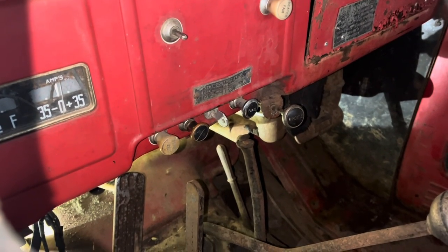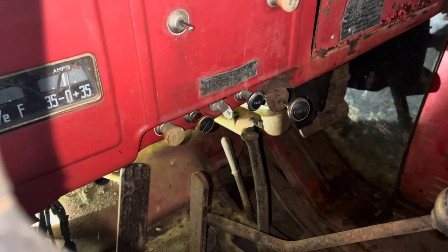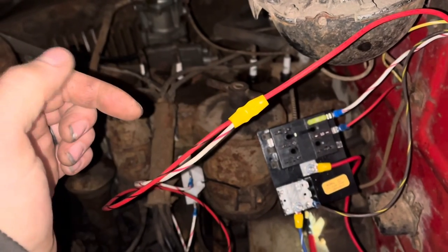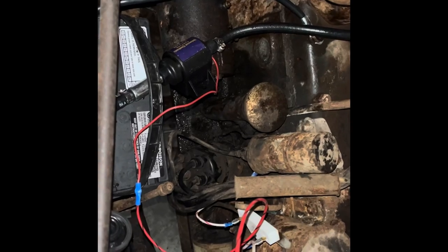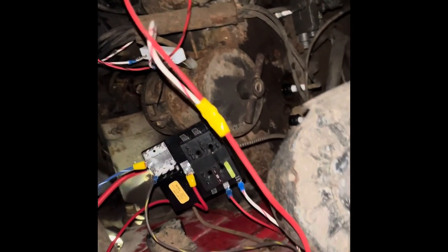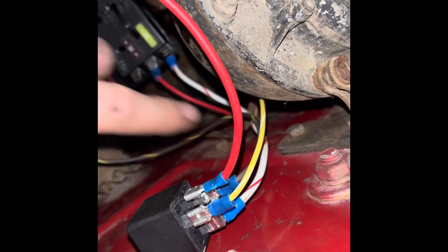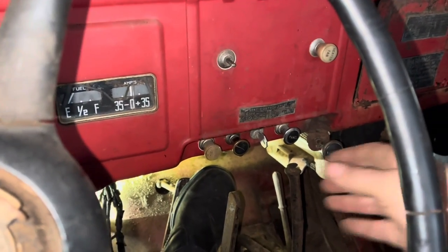You can use just about any kind of switch you want to trigger a relay. I'm pretty fond of those $11 universal ignition switches you can buy at the parts house in the lawnmower section. But in this case I thought it would be nice to reuse this original switch with the original key — and lucky for me, it works! Here's a dirty little trick I like: two smaller wires and a yellow splice together — works very well. Again, this really needs to be heat shrink. This is pretty much all temporary — the mechanical pump on this actually works, so I will be eliminating this. But in the meantime, I have an ignition and a fuel pump together powered by this relay. Battery feed input on the back side — that's pin 30. Output here — pin 87. Pins 85 and 86 get power on one and ground on the other. Doesn't matter which is which.